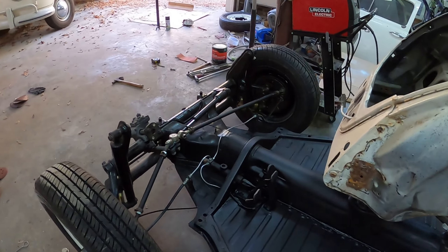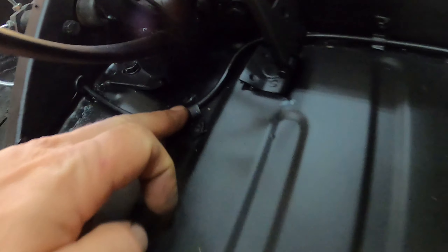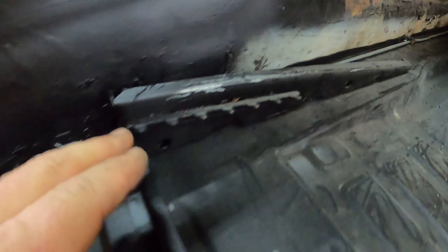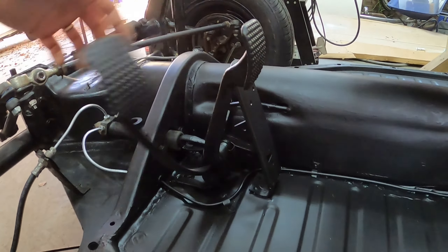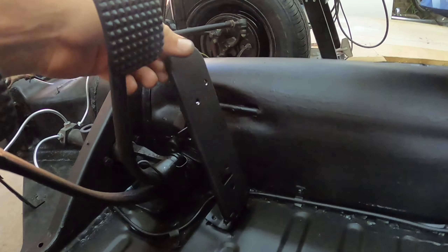I've made some good progress. On my front left, I had to weld down two little hold-down straps for my brake line — one here and one here. You can see I just did a little bent piece of sheet metal, did one spot weld, covering this with a leather weld smock. I'm running this down and it's a little bent out but I can't really get that in. It comes all the way down and I've gone up to here with my paint, painted where the pedals are. The basic pedal mechanism works great and is now painted.